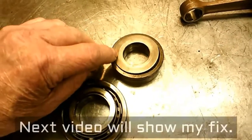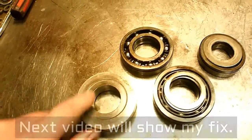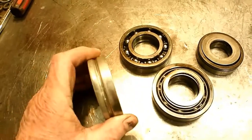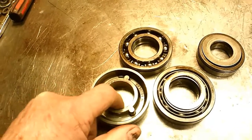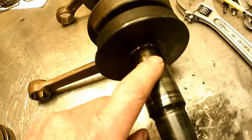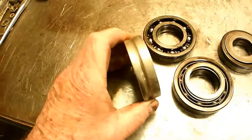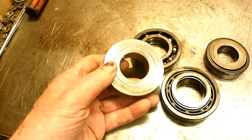So I'm going to cut this spacer down a little bit. This one here obviously makes a difference which way you put it in — you'd want to put this side here closest to the engine, closest to the connecting rods and so forth. This is just a spacer for between the bearings, but it's cast and it's open in here. This fits fairly close to the shaft, but there's clearance between it, and that's the only way that oil has of getting through here, is right where that shaft is turning. They haven't cut a turbine or anything here on the shaft to try to drive oil this way. So this end bearing here, it's going to run really hot I think. So I'll probably make a modification to this. There's an O-ring that fits on the outside of this that keeps it from spinning, but really it's just a spacer between the bearings.